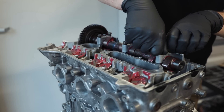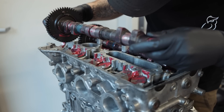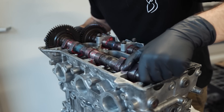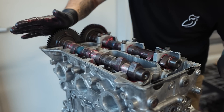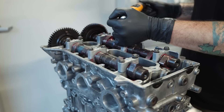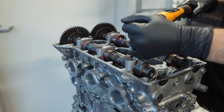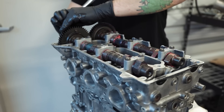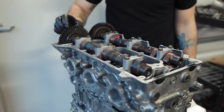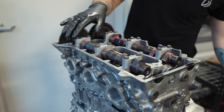For the fun part, I'm going to get the other cam cleaned and lubed. On the backside, this notch is also going to face upwards — there should be a dot right there, and that dot is going to line up with the other one. Both notches are facing directly upwards. We have our service screw in there. That went way smoother than it should have, which is a good thing. The service screw is just a sprung screw that holds all this together for the intake cam — once it comes out it unsprings and locks in place to the exhaust cam. Cams are in on this side.